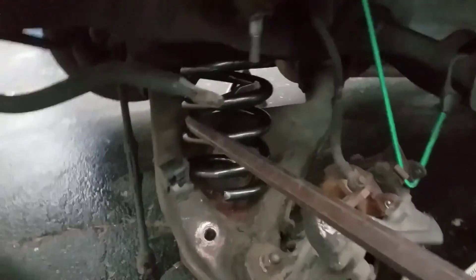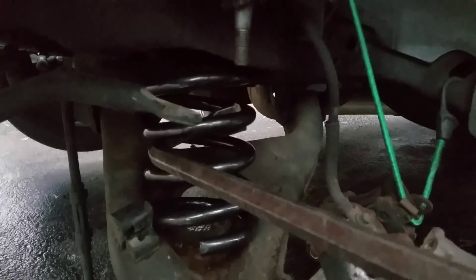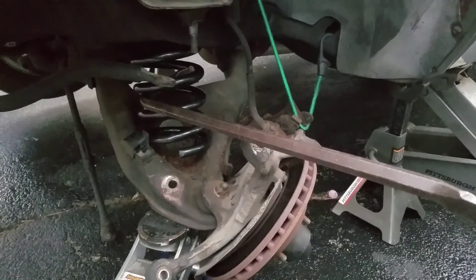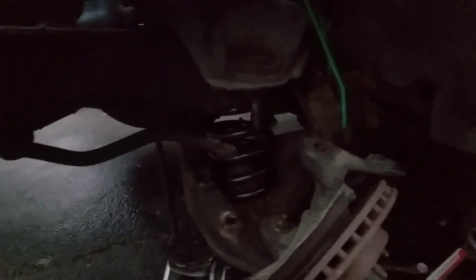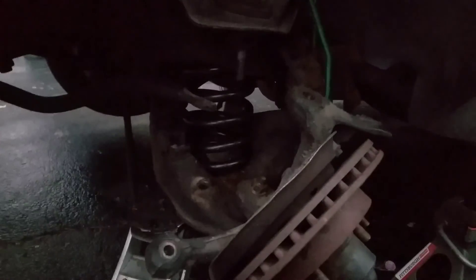This is how we're putting the coil in: we wedge it a little bit while holding the spring in place and also holding the rotor, because we didn't want to take the bottom all the way out. We're using a crowbar to pry it back, then hitting the corner of the coil spring with a hammer until it eventually pops into the bucket, and then you can just lift it up with your jack. Old school spring compressor right here — no ratchet straps, nothing like that, just gotta manhandle it. For those who doubted us, turns out we didn't even need the crowbar — just a little bit of finagling and it's in there.